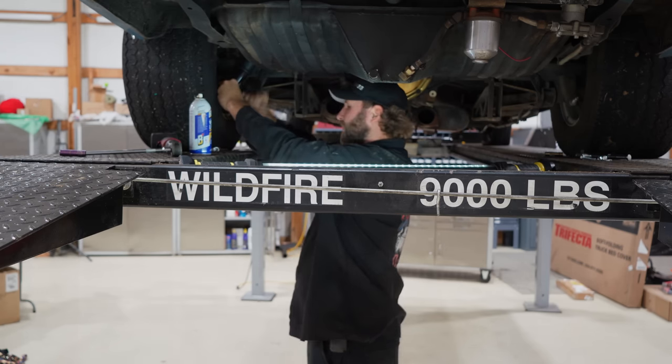It sounds good. Might be a little fat on the back end. I'm going to have to keep an eye on that. Well, I think surprisingly, it's a little fat on the secondaries, which I haven't really had that happen with the Brawler. But that's okay for today. We want to be fat and happy on the rollers. We don't want to run this thing lean. Plus, we're still figuring out the specs. Didn't build the engine. I don't even really know what compression we're running. So I think this is good enough for now.